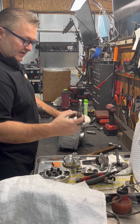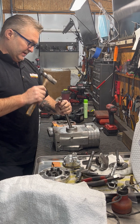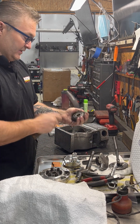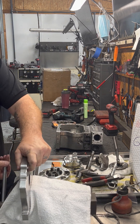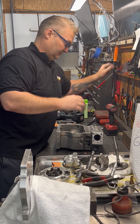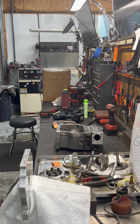Next part — pull the other side of the crank out, then go over to the mag seal, pull that out, come in here and take the bearing out. The reason I took those bolts out of the main boss is so that the whole boss comes out with it at once. Pop that out. Get my side cover in my vice, same thing — pull the seal out of that, then pop the crank bearing out. Bearing came out.